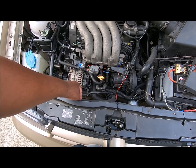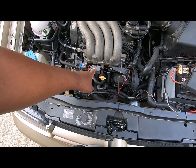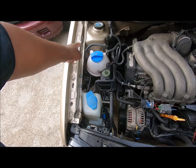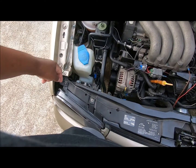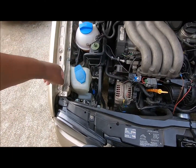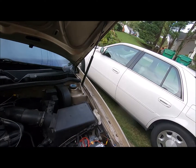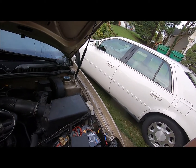The low speed on this fan runs through that sensor. This other fan is only used when the air conditioning is on — on low speed it gets power from this wire here. When I turn the air conditioner on, it sends power to the AC compressor, and this wire sends power to this relay. That's how I've got it wired up — it's not the Volkswagen way, but the fans don't run all the time.